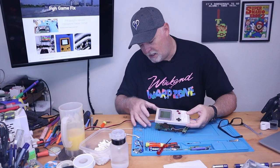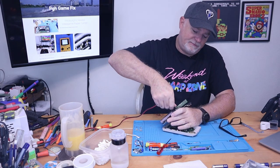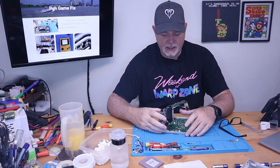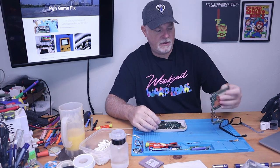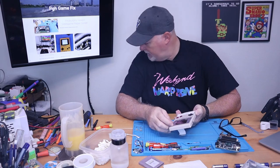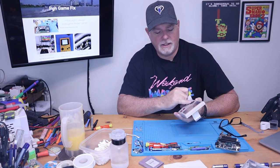It actually looks like this one's okay. So we should turn off our output. This was a simple one, but the reason I wanted to make this video in particular was just to show some diagnostic methods. Let's go ahead and finish doing a cleanup on this since the customer would like it running again. We know this board is okay, so we should take out this board — I believe we have more of these screens — and we'll clean behind the membranes. Give me a moment while I check.